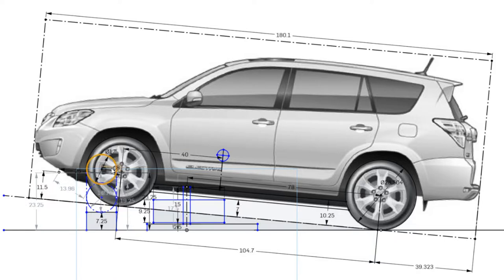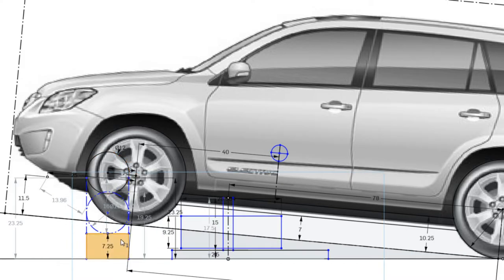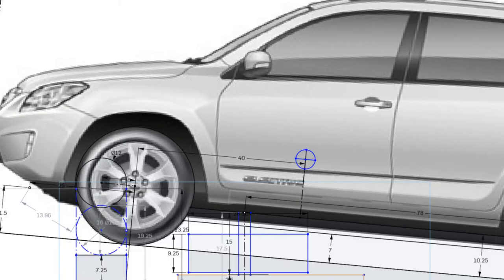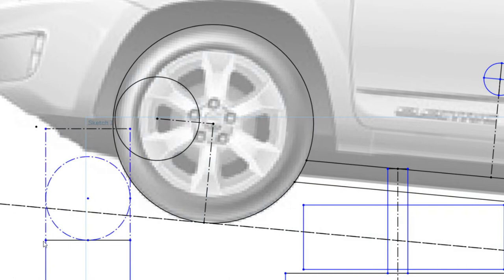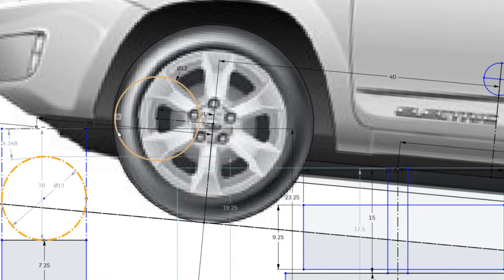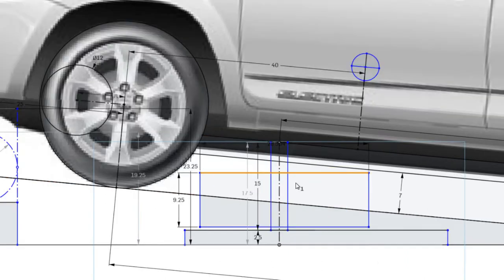The drive unit is located roughly eight inches in front of the front axle. The car will be lifted roughly 17.5 inches — 15 inches being the max height of my jack stands, plus a 2.5-inch stack of wooden sheets. The transmission lift will be used to drop the motor, and that car height will give enough clearance so the drive unit won't hit the car. For safety, we'll also put the front wheels of the car below the car between the two jack stands.